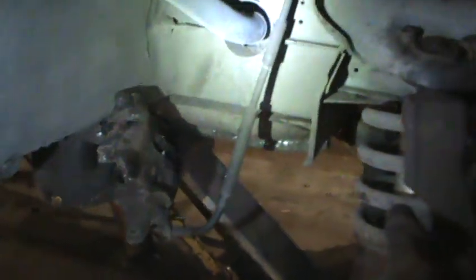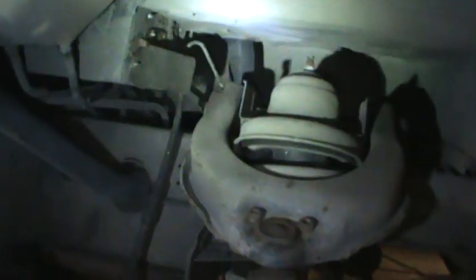I think the next thing I'm going to do is order parts — there's really not much more I can do right now. The other side's done too, same thing — caliper's cleaned up, piston squeezed right back in. The lines look fine, no breaks or cracks. A little bit of rust but nothing bad. The underside underneath actually looks really nice — just a layer of undercoating, and if you scratch it with your finger, it's just paint right under it. Everything looks pretty good.